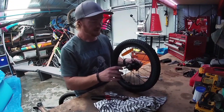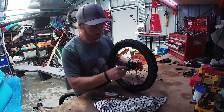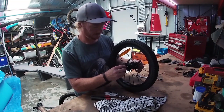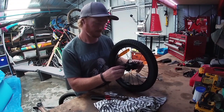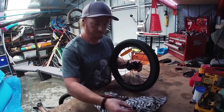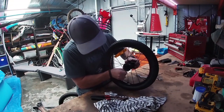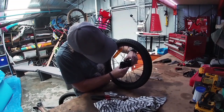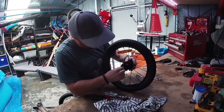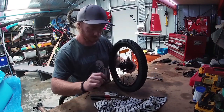I'll wind this out now. Basically you just spin the axle and it'll come out itself — wind itself out. We're trying to spin it with tools. I'll sit that down there, pull this shaft out of here, and pull the coaster brakes themselves out. That is what we want gone — it can go in the bin.